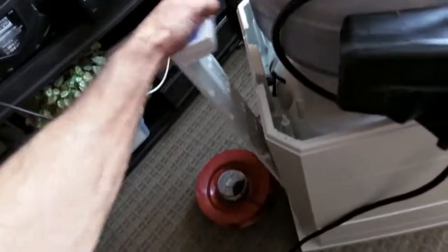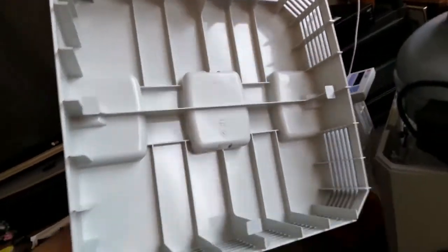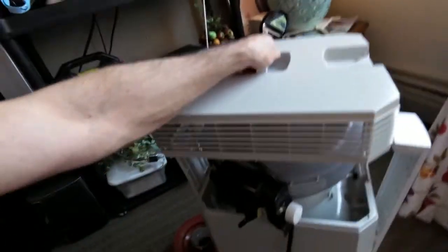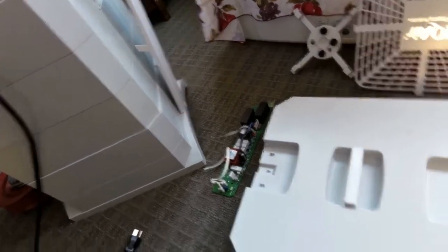I'm going to remove these side arms — I see no need for them. I thought about putting them on somehow but that's pointless. I've always thought it was a design flaw of the IQ Air how they had the motor blowing air up at a 90-degree angle and deflecting it. When air meets a 90-degree turn with all these plastic ridges, it adds a lot of resistance. I know IQ Air did that to make the unit look more aesthetically pleasing, but they really should have had air coming straight out the top rather than trying to push it sideways.